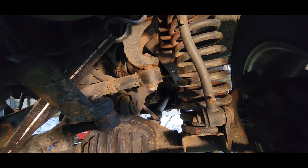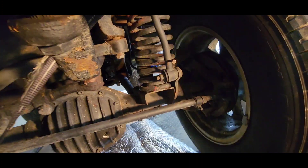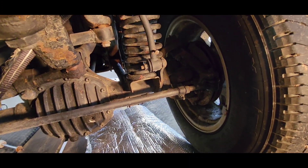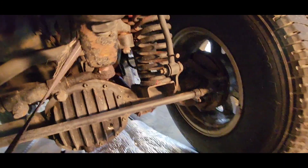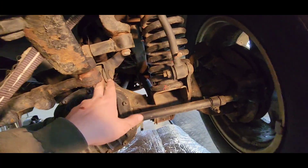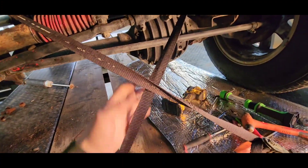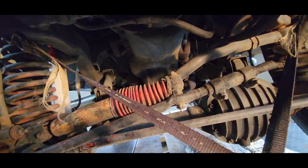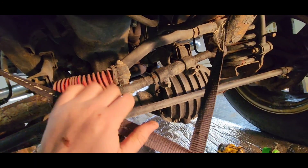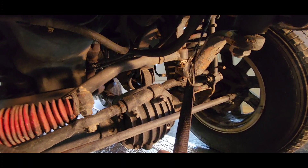I'm hoping I can just tighten that up, but chances are we're gonna end up putting a new bolt in there. So that's where we're at today on our weekend update. Also, if you take this bolt out, it's really just friction on these upper and lower control arms that keeps everything kind of in place. So we cross-braced with some ratchet straps down to the lift and up to the frame to make sure nothing moves, and I can use them to move stuff forward and back to help line that bolt back up.